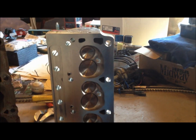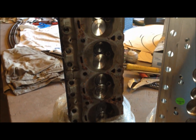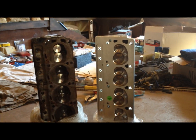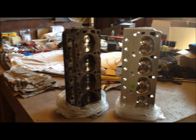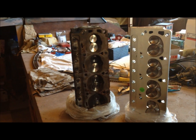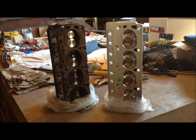Really, most aftermarket heads — all the ones I've ever seen — don't have that crossover port, so that's something to keep in mind. I'd love to hear from anyone with info about it, because it's a pretty substantial port and it's not on both sides. They did carry over this little port here. Anyway, I just want to mention this before anyone goes slapping one head on the other engine. I called AFR and they didn't necessarily know what I was talking about — it seems like no one really does. So be aware: two different style engine heads for the same style engine.